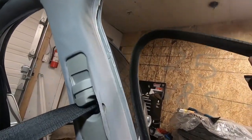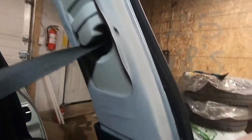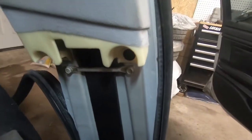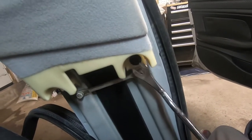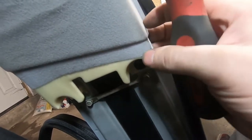For the B pillar, the first thing you want to do is remove the rubber seal around your door — it just pulls off. Do the same thing for your rear door. Then come down to the plastic piece. There's a plastic clip originally tied around here, so stretch it forward and manipulate it to get that clip off, then do the same on the other side. Pull this back enough to get to the two clips down there — one on each side. These are BMW's two-piece clips, so you pry off the center piece first and then pry out the second piece, and that'll unclip the bottom.